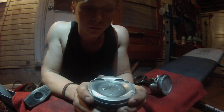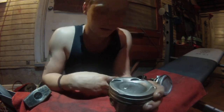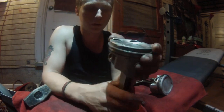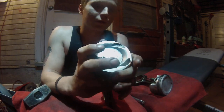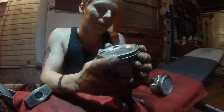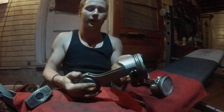Carefully compress the rings and tap them in with the arrow facing the timing belt. Looking from where the intake manifold sits, or from the front bumper, the arrow should be facing to your right. Make sure everything is facing the right direction when installing. Be very careful — I've seen people break rings while installing them and I've come close myself.